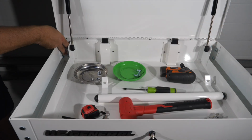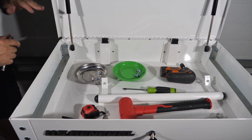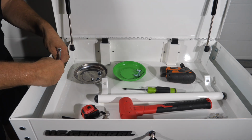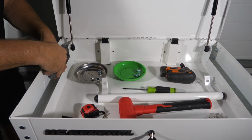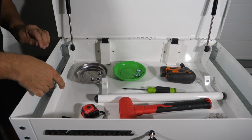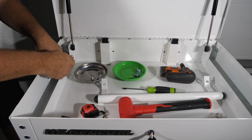And now finally we want to tighten all these bolts on the inside of the top of the box. So everything's tight. Up to this point we've got our struts on, so the top is out of the way. You probably want to get you a 1/4-inch drive ratchet and socket and a long extension, and get these here in the galley, and then you'll have to get the ones on the side with a wrench. You could probably get these with a wrench too, but much easier with a ratchet and an extension.